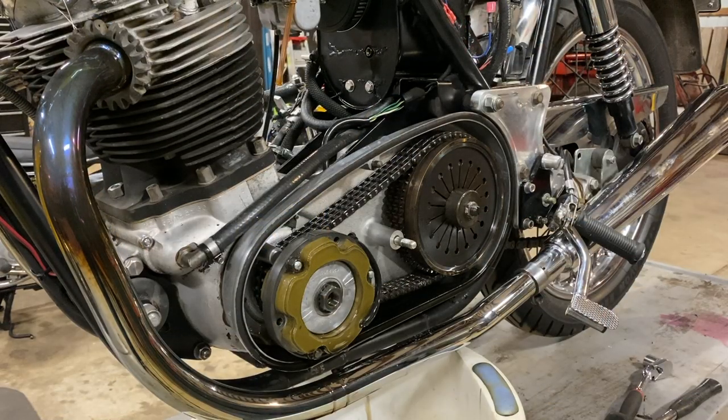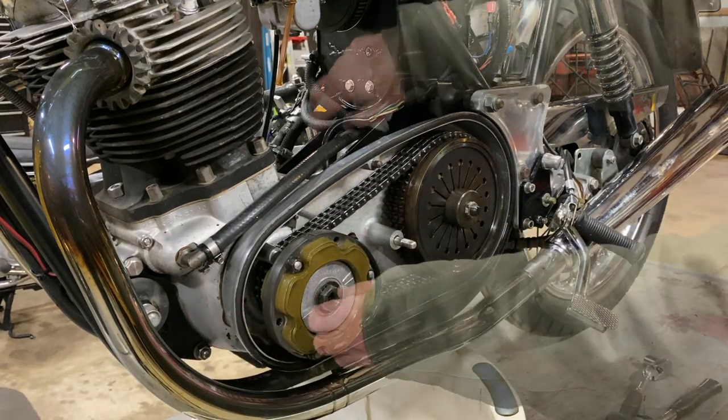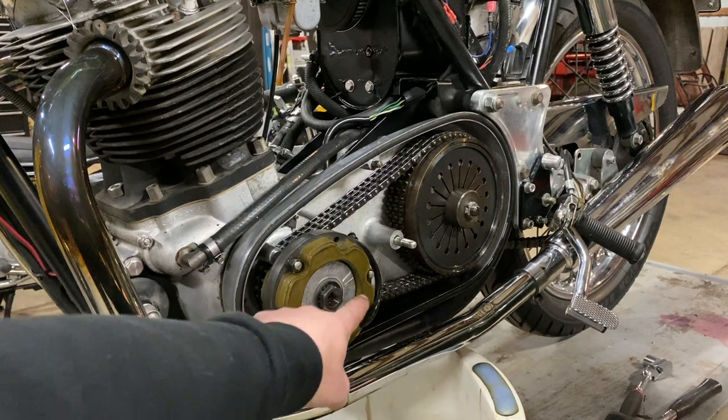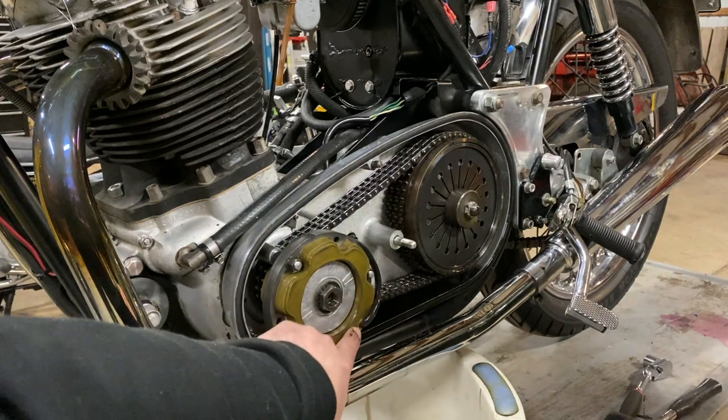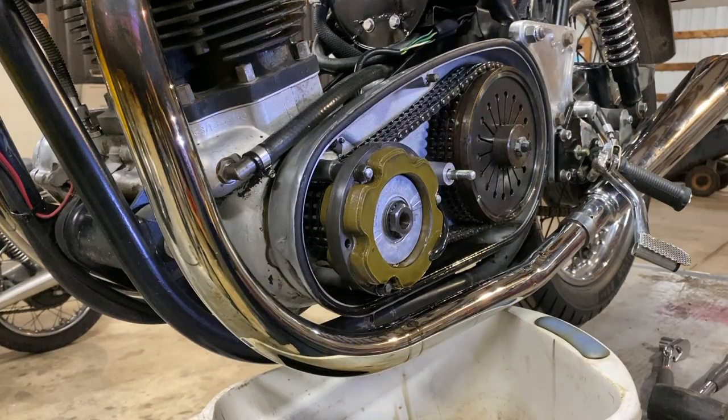We are starting to disassemble the clutch and the stator and the rotor — it will all have to come off, the whole lot. I usually kind of take it off and then let it dangle, cable tied so you don't put any stress on this point here. Then disassemble the clutch and then the front sprocket as well, and they come off together as one unit because it's a continuous chain.